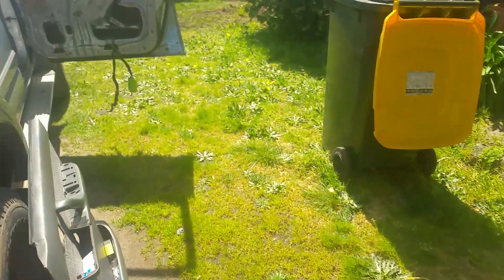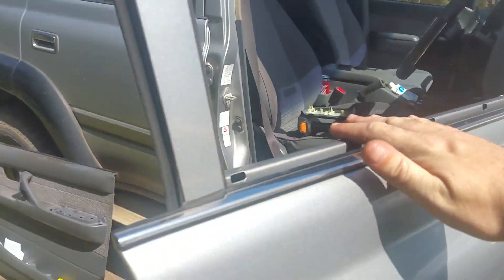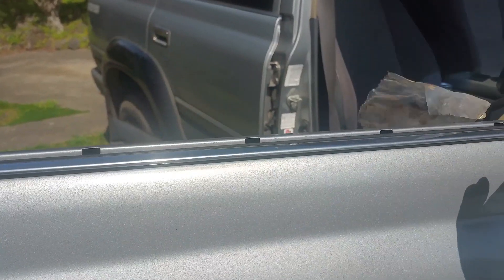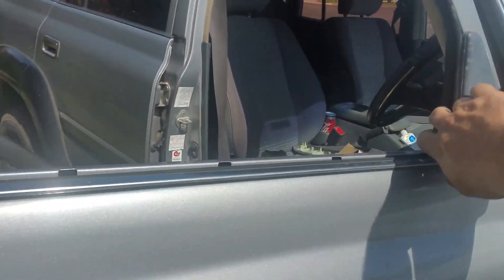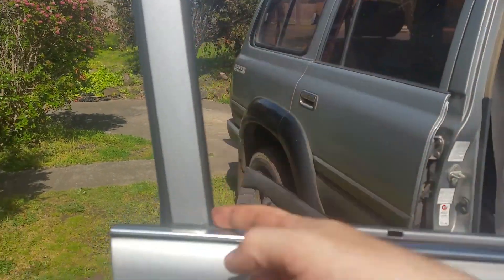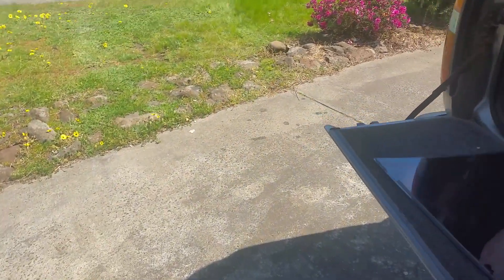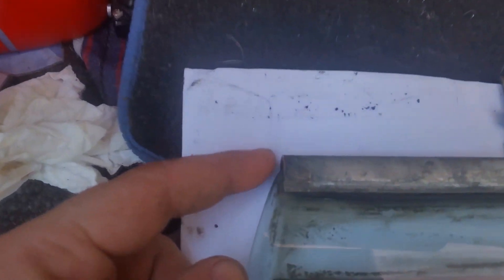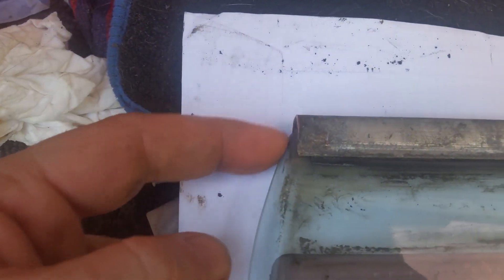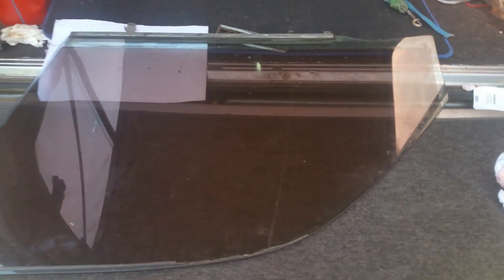We've got this seated now. To put the window in it's actually quite an easy job, but you are still going to need two hands. You basically slide the window in from this side of the car at 45 degrees, so that you can at least get this end of the window in there, and then simply slide it back down. Just make sure you've got a little lip just there on the outside of the mounting brace, in order for the glass to actually fit into the Bailey channel — otherwise the thing won't line up.